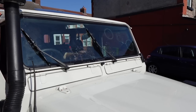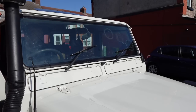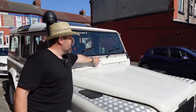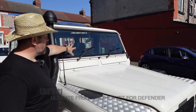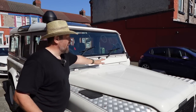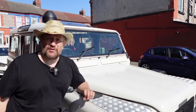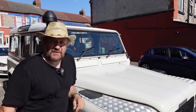Although the jet looks very low, I think when you're driving, the water is going to rush up the windscreen and clear really nicely. I do think our washer jet pump is a little bit low on pressure — that might be something we need to upgrade. But all in all, I'm incredibly surprised how easy that was. If yours is broken, 100% replace it with one of these aftermarket heavy duty ones — better distribution of water, more effective, and so much easier to fit. If you're fitting one of those cheap plastic aftermarket ones, you will hate it. It is probably the worst job in the world.